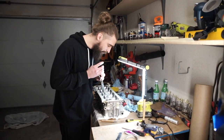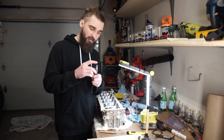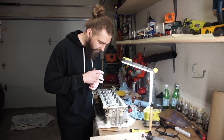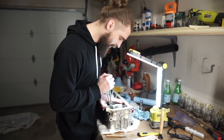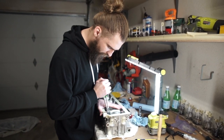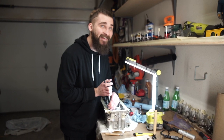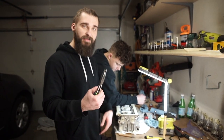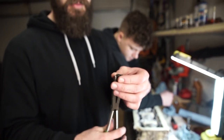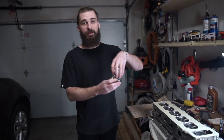Meanwhile while they're all soaking, you want to remove the valve seals — those are a pain to do. Take some pliers and since they were sharp-nosed, we cut them with a grinder to make them more flat so they have more grip on the inside of the seal. Those seals are really tied up in there and really annoying to take off. You squeeze and wiggle it around to remove it — this takes a long time. There are 20 of them per head. They're aluminum, they bend like nothing, but you need to replace them anyway.